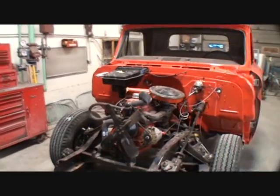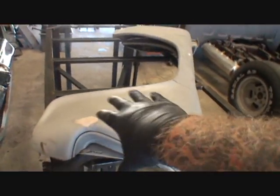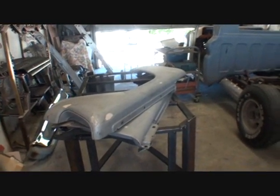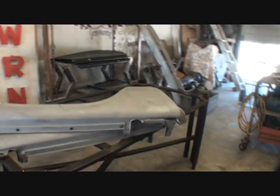The next step in restoring our 1966 Chevy truck was to completely dismantle all of the front-end parts — the inner structure, the outer structure, the fenders, core supports, and so on. We hauled those down to the sandblasters, and that's basically what we have here. These are in bare metal form, sandblasted inside and out. I normally don't suggest getting the outer panel sandblasted, but since this is a 1966 Chevy truck, the metal is super heavy duty and there's no chance of warpage.